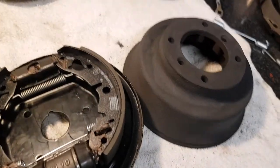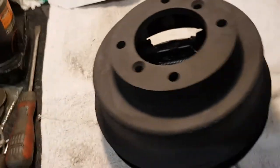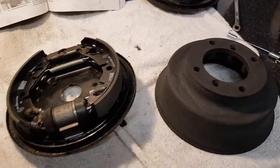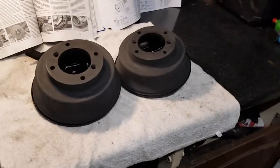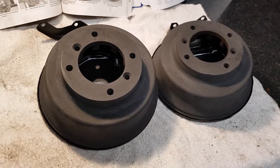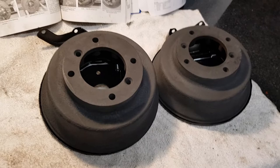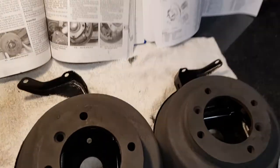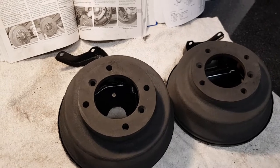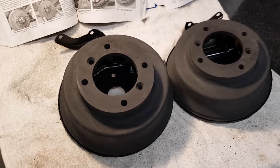There's the painted drum ready to go on. I haven't got the hub on so it's not really going to go on properly yet, but I just need to do the same to the other side now and then both are done. They all get wrapped up and stored so they don't get contaminated with dirt or grease, and I'll probably put them on the radius arms after the subframe is in — I think it adds quite a lot of weight to the radius arm and subframe assembly. The only bit I couldn't do was the two handbrake brackets on the back because they use two of the three screws which hold the radius arm onto the backing plate.